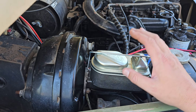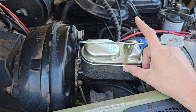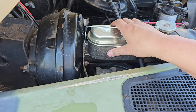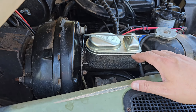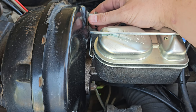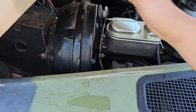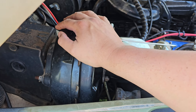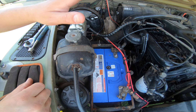The current problem is the same as when I started - as soon as I put vacuum on, the pedal goes straight to the floor. A lot of people said I need to bench bleed the master, and yes they're correct, but the problem is no different to when I started. I may have a vacuum leak, a bad check valve, or a bad booster, so we're just replacing parts until we find something that works. Today we're changing the booster and the vacuum lines.